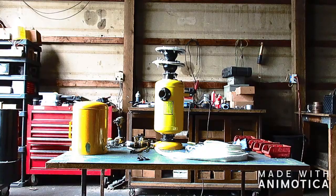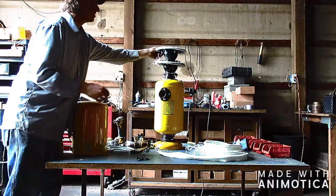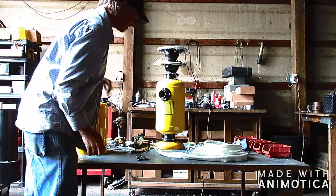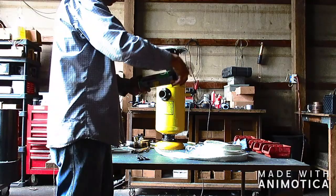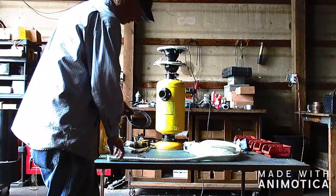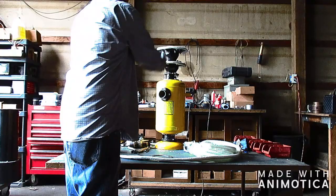Okay, so this will come with 2 1-inch wide flanges. This flange here, this is your clamp for clamping on the rope seal. And basically what you're going to do is apply some contact cement to the flange of the rope seal, coat that, and then put a coat around the ring, and then let it cure, and then you'll stick the two together and you'll just work it around just like you do the other seal. And then basically you install on here, you put a hole and clamp it down. So it's not too big of a deal.